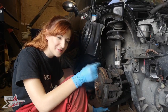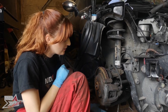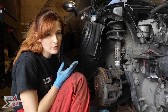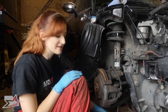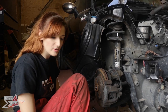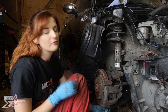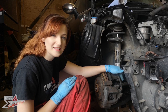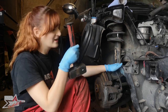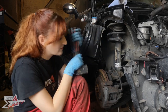I accidentally forgot to record that. Basically the lower ball joint bolt was really enjoying its time stuck there, so we had to end up getting the breaker bar out and then that came off. I've kind of put it back on a few threads now so I can hit the wishbone - gently - to try and make it come free and go back down.